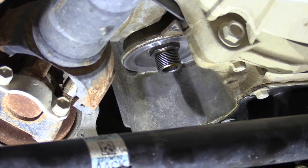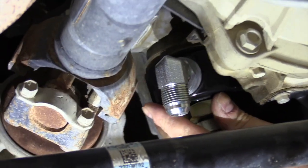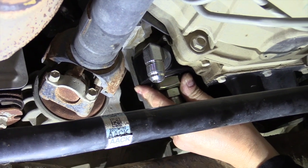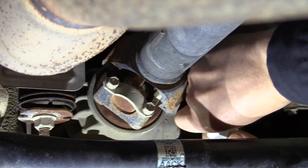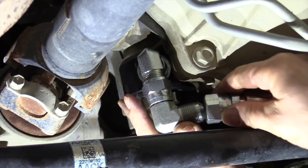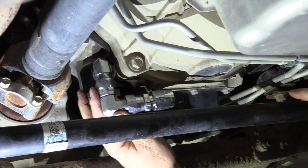Next thing we're going to do is start putting on the adapter for the engine oil. I wanted to show you the difference between the AMSOIL adapter and what I'm going to be using. The AMSOIL adapter has the dirty oil coming in on the outside and clean oil going up the center. If you look here, we've got a drive shaft right there. I can swing it over and get it into this general area and probably be fine, but as I try to run my hoses over to the passenger side, I'm going to show you the angles I have to deal with and explain why we're not using that particular adapter.